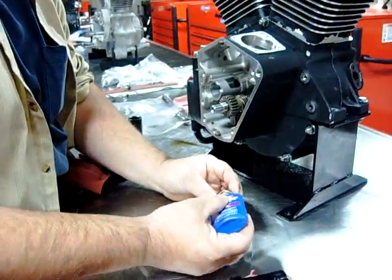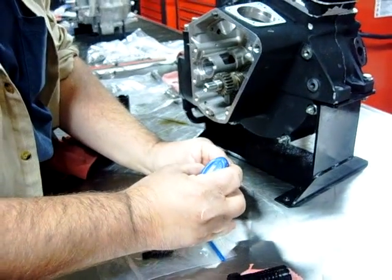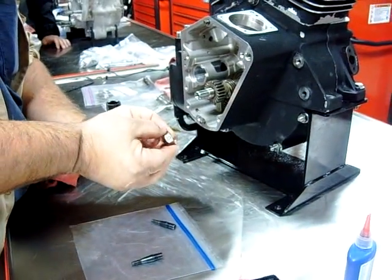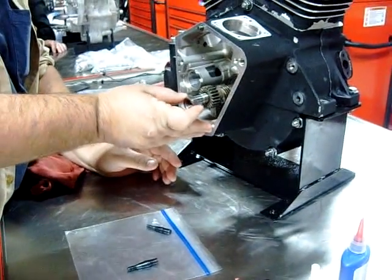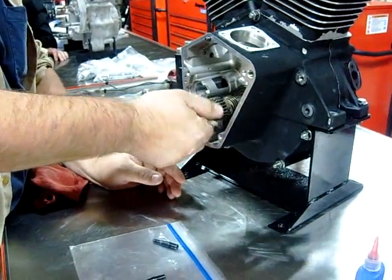What we're going to do is torque this down in multiple steps, like we've done in every other video. So our first wrench is set up at about half the torque. The final value was 45, right, guys? Yep. Make sure you give him the right torque wrench, the one that's set smaller here.